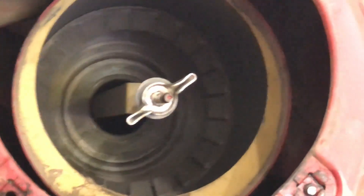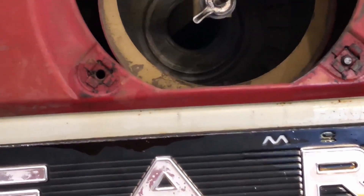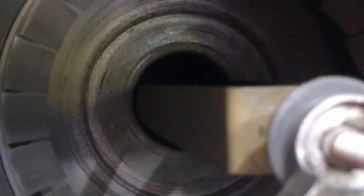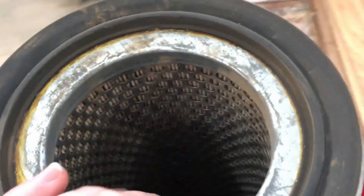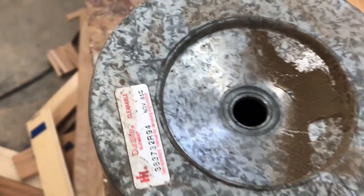I decided to take the air filter out first, just as a precaution, because I haven't taken that out in a while. I accidentally broke the bolt right there — I forgot to put some WD-40 or penetration stuff on it. I did on the other side and got the left one out pretty easily, but not the right one. Looking at the filter, I don't think it was sealing very well. There's dust on it but most importantly there's dust forming on the inside, which is probably why I wasn't getting a good seal. The filter's probably fine, it just needs to be sealed better.